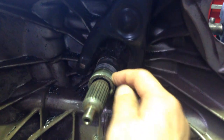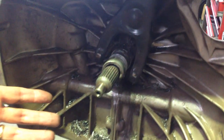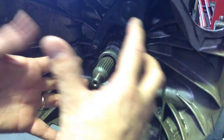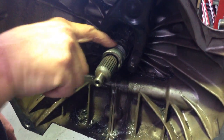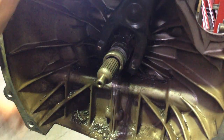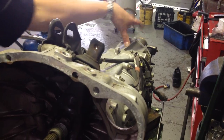This particular part of the gearbox housing here is a tube which is split in two halves, which is part of the aluminium housing in the gearbox when you dismantle it. The unfortunate part is this cannot be repaired, so when you damage this part here, all of this and all the back of the gearbox — except the transfer case assembly — has to be thrown away.